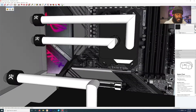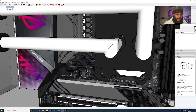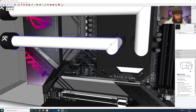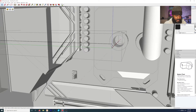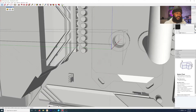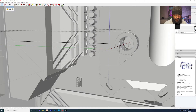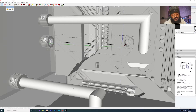The second challenge is going to be leaving the distro plate and going into the CPU. This is probably more easily solved by an offset fitting, because the distance is less than 10 millimeters — actually about 3 millimeters. So this distance between this fitting and that fitting being on the same plane is 3 millimeters, and with the offset I'll be able to adjust it so that the tube run is as parallel with the fitting as possible, because we're looking for straight runs and easy bends.